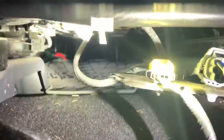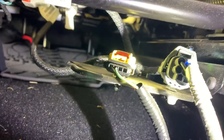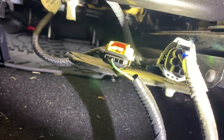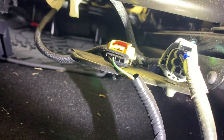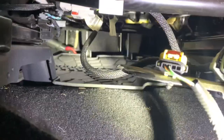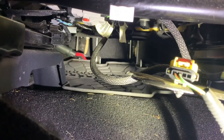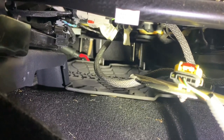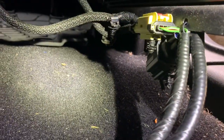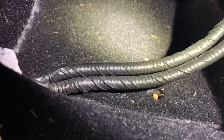I'm going to try my best to show you what I have to take off. There's a little plate that the wires are sitting on, and there are some T30 Torx screws — you can just see one on the edge right there. There are two of those, and you have to remove that little plate. You need to remove those wires, and those wires will zip-tie into the holes that you remove the T30 Torx bits from. Just have to pop those wires loose — you need a little push-pin to do it. Just pop those wires out, remove the plate, and re-zip-tie them. I'm hoping that wire right there is high enough — everything should clear and we should be good to go.